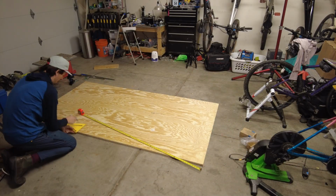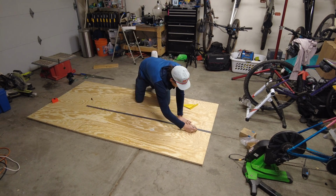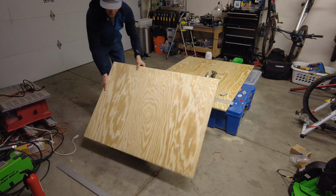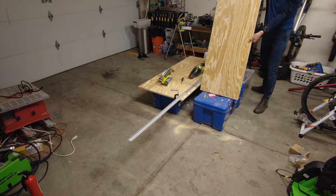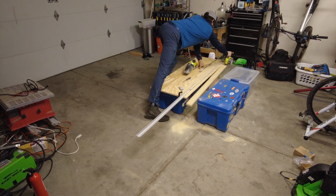Once you've assembled all the materials, it's time to start cutting. Make sure to use a good straight edge to mark and cut, as this will make your tray look and function far better. Cut the large base section first, and then measure and cut the sides as well as the back of the tray, and finally the side panels that will mount to the van.